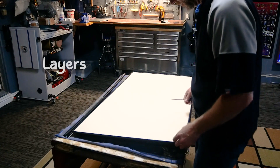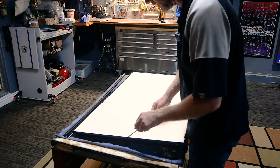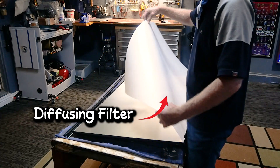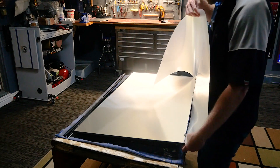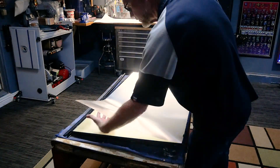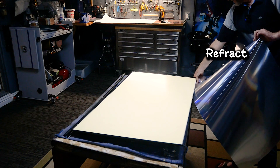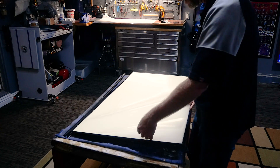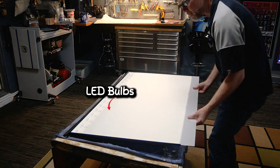There are going to be a bunch of layers on this TV. That first one was the LCD crystal — the glass and LCD pixels that cracked with the Nerf bullet. The next layer is an important one you want to save: this is the diffusing filter, which really makes this whole project key. It helps diffuse the light and makes it look really good for film production, so you want to keep this. The next layer refracts the light beams — keep that one too. And under here are the bulbs.